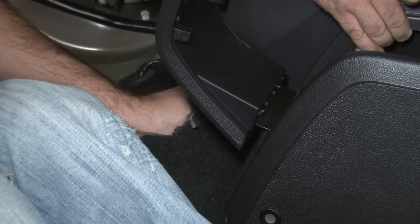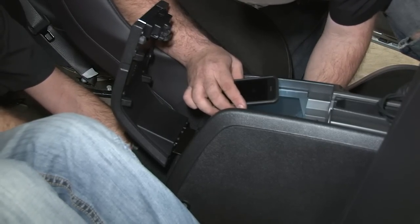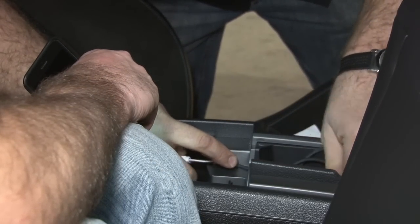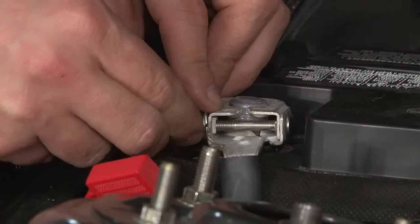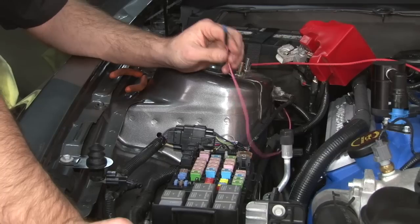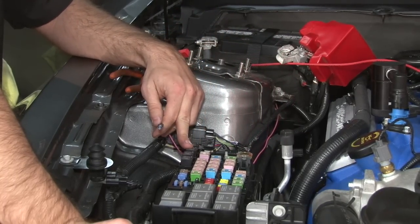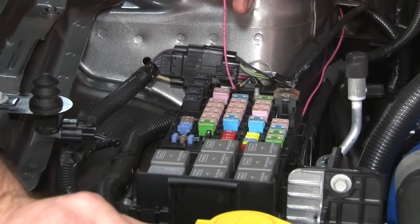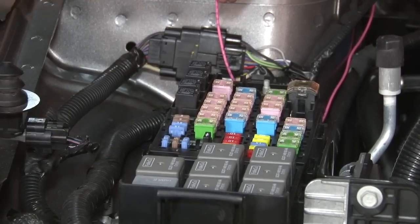We just finished wiring up the controller. We ran the wire underneath the carpet up into the center console to give the owner some options — right now it'll just sit in the cup holder, but you can mount it if you like. We're hooking up the battery ground and the power wire for the compressor directly to the battery positive. There's a small pink wire for the ignition source. In the fuse box under the hood, we're looking for a circuit that's hot during key-on, engine start, and back to on. In the Shelby we found an engine 2 port — there's a nice add-a-fuse circuit that goes right in there.